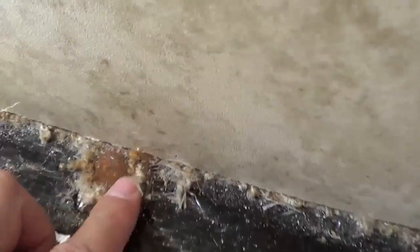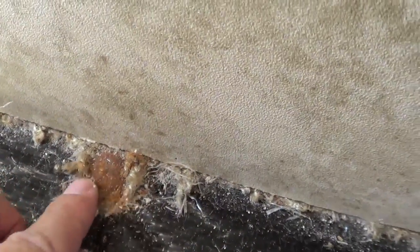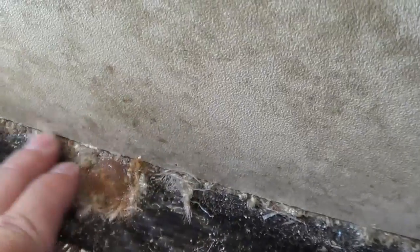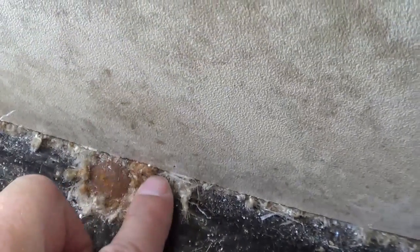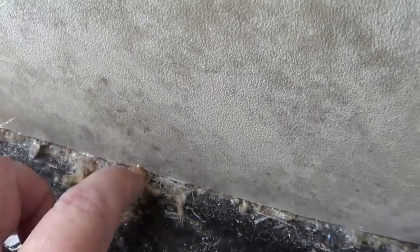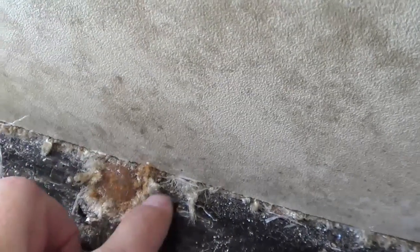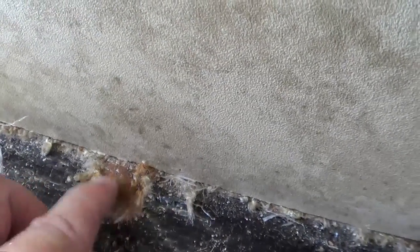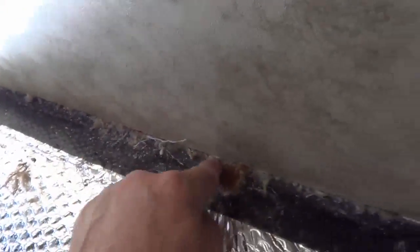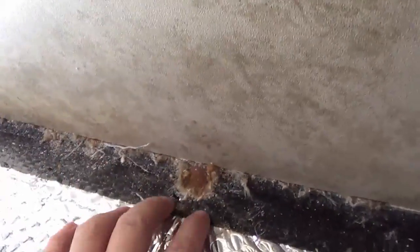The only other thing I noticed is in the slide area, right there you can see that's probably a bolt going through to the other side where the floor is bolted down, or some of the slide hardware is attached. They put the carpet down first and then put the bolts down, so there's a little bit of carpet jammed right under those bolts. They have those every few feet. So if you find the bolts and then run the X-Acto knife along, you can pull it out section by section.